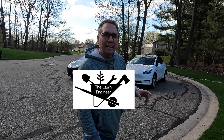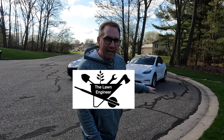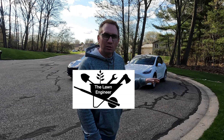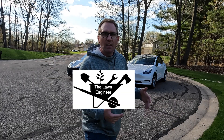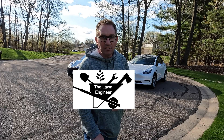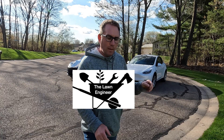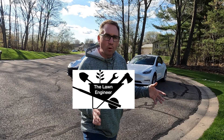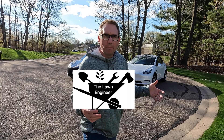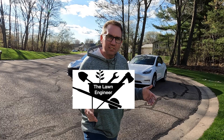I'm going to do the battery health check on both and see which one is doing better or worse. I would expect the white battery pack to have more degradation for a couple of reasons: it's a smaller battery pack, the use case is the same daily driving, and it's older with more miles. The blue has a slightly bigger battery pack, so theoretically with fewer miles it should have fewer cycles and less degradation.